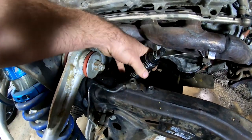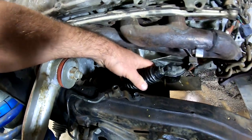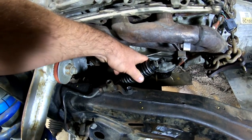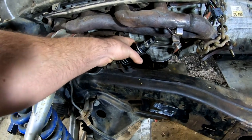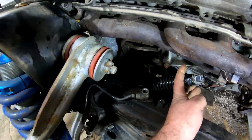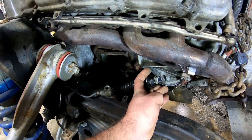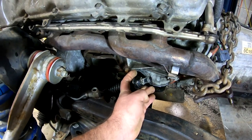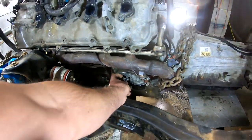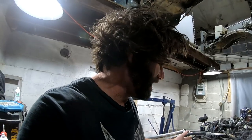Here's what I'm talking about right here. I left this kind of bolted into place down here so I could play around with it and see where it's going to have to sit. For me, it's probably going to come up right about at this angle, and right there is where the mount has to bolt in. I know there's no way I could have put the Tundra mounts on this one — not on this side anyway. On the passenger side there's plenty of room, but not over here. So let's get right down to business and make some mount brackets.